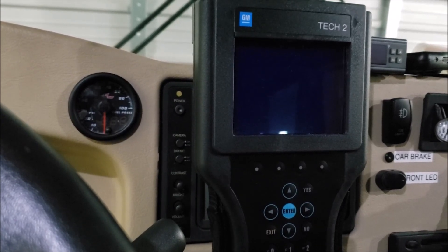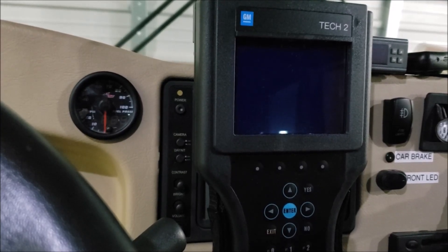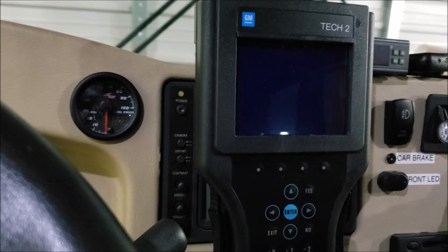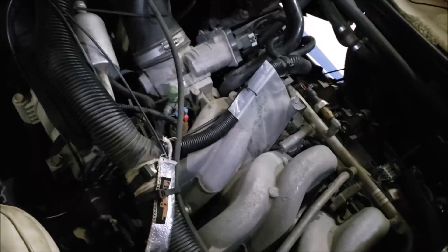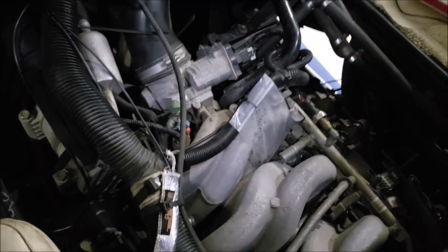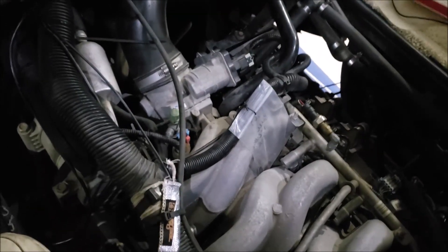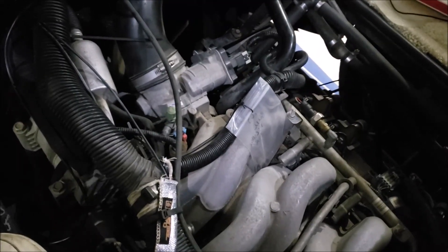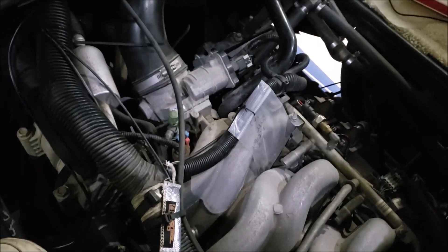So many people — even mechanics unfortunately — don't diagnose, they just start throwing parts. They say, 'You've got a misfire on your 8.1, it could be an injector, let's just put in a whole new set of injectors — that'll be a thousand dollars.' Then you get done, pay your bill, and you still got a misfire on the way home. Then it's new coils, plug wires, it just goes on and on until they happen to get it right. With the proper tool you don't have to guess — you can really troubleshoot it.